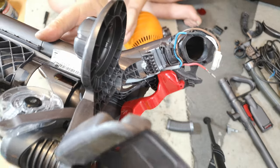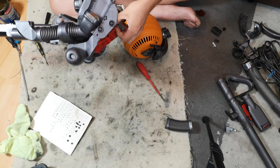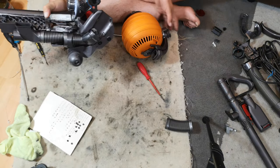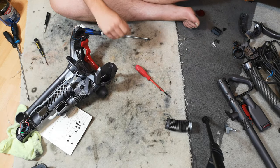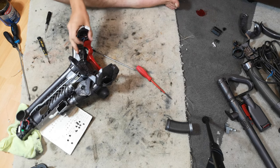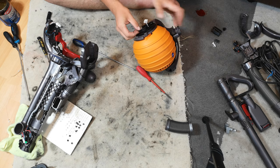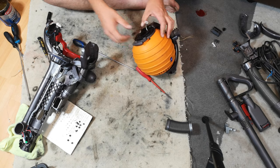through, I didn't show you that, those two channels there, and then feed this red cable out into there. Like so. So all of the wiring is out of the way. We then need to not forget to put the seal back on, or you'll soon regret it when it's all nicely bolted up and you have no suction. Again, ask me how I know that.